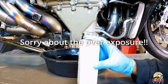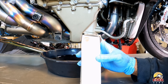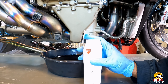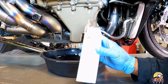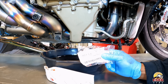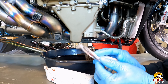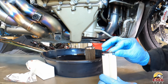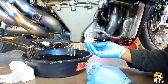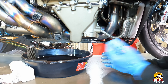Here's our Ducati genuine parts oil filter. I've used Ducati genuine parts, high flow filters, and K&N — it's completely up to you. I happen to have a Ducati dealer about 10 to 15 minutes from my house, so that's why I'm using them. There's also an O-ring kit with a part number — it has two O-rings and a crush washer. Put a little oil on the surface of the O-ring, set that aside, then fish the new filter up in there and wiggle it around. It'll pop on and make a little snap sound, and then we're good.